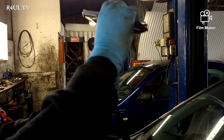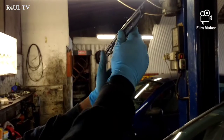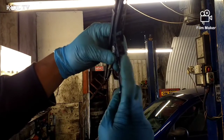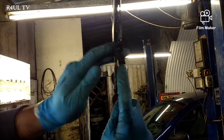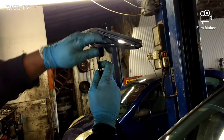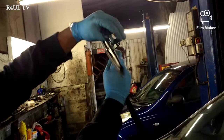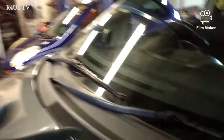All we do with these — 9 times out of 10 — just pull down on the wiper blade and it comes off because the clip's a bit worn out anyway. But if it doesn't come off and it's pretty new, as you can see there's a little clip there. Push down on that clip — I've got a firm hold here — push down on that clip and then push the wiper blade down and it should just come straight off. Once it's off, move it to the front, lift it up, put the arm down nicely so it doesn't crack the windscreen, and then replace it with the new one.